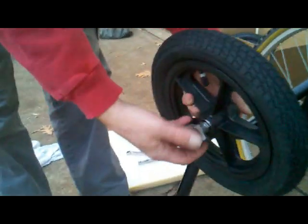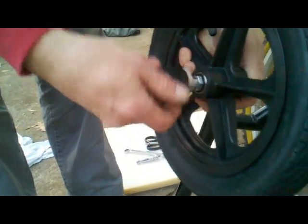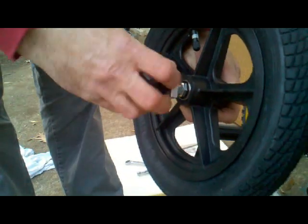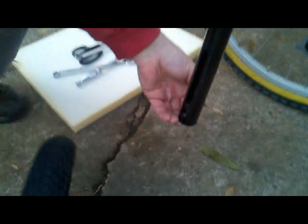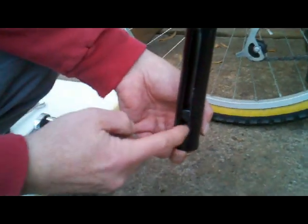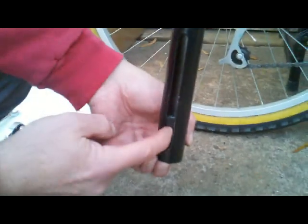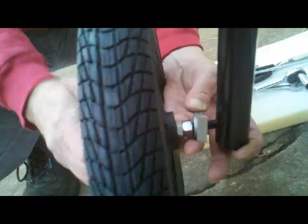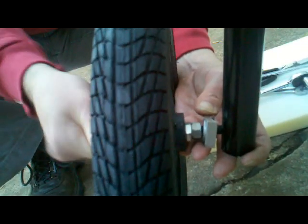The wheels come with these knurled plugs and a curved washer already mounted on them. Each one has this set on. You have to take this off and slide it up in the tube. And this is going to be hard to see in the video because it's all black. But there's the threaded portion of the tube, and here we go. See the curved washer. Okay, so we've got the threaded insert in the tube. You have to make sure this is square now, so the thing will thread properly into the insert and not cross thread. You tighten it with your fingers.